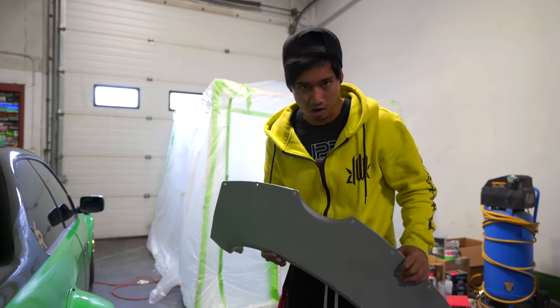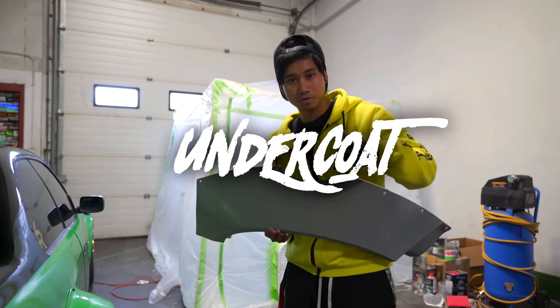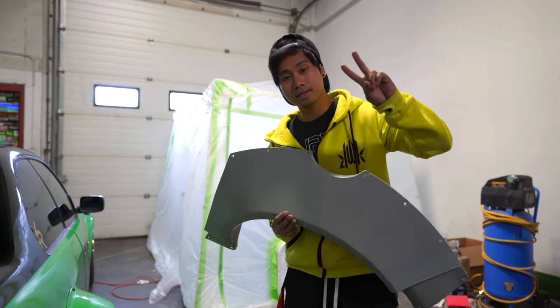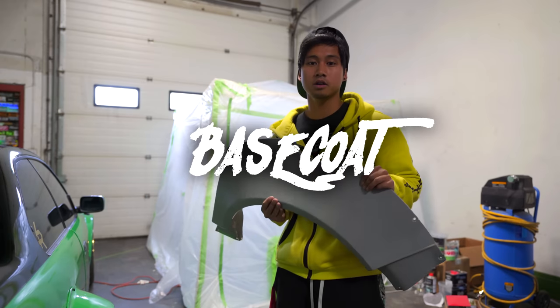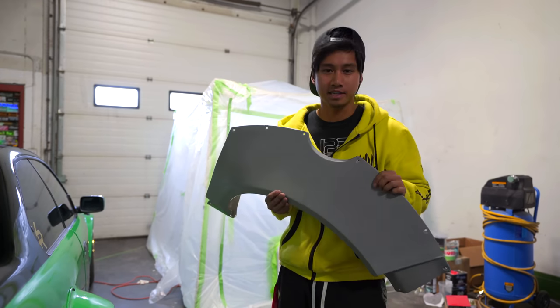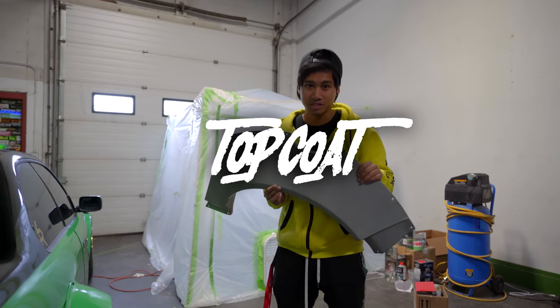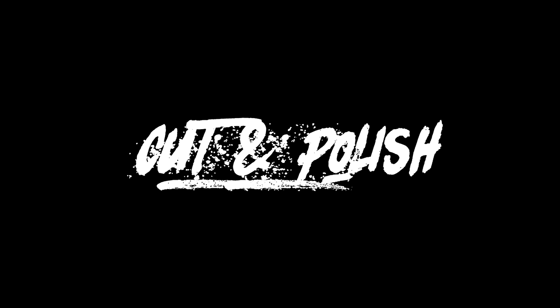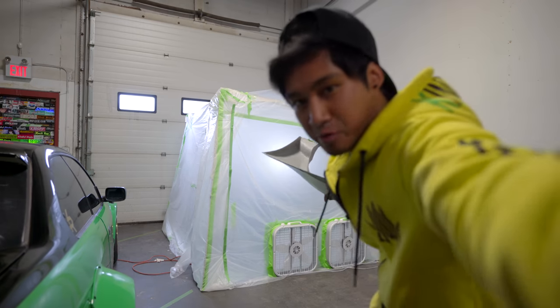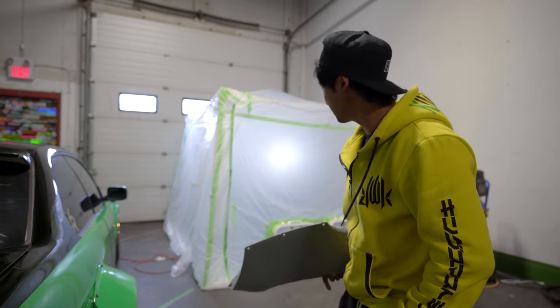So when it comes down to painting a car, or in this case body kit pieces, or any part for that matter, there's three basic steps you gotta follow. There's the undercoat, which is our primer — a step we've already gone through. Then the second step is our base coat, which is the color of the paint. In this case it's lightning yellow, which is actually the factory name that Mazda gave the RX-8 color. Then we gotta finesse it and make it showroom glossy, so the third step is our top coat, which is the clear coat. I forgot there was a fourth step — the final design, cut and polish. This is only real if you suck at painting and the orange peel is super noticeable. Like me. I know this paint booth you see behind me is super makeshift, but honestly for a DIY it's not bad, and if we're really careful it'll get the job done.